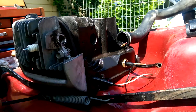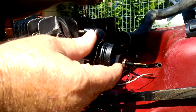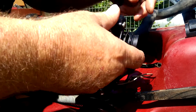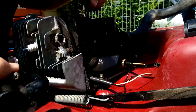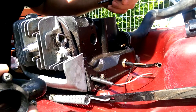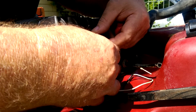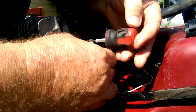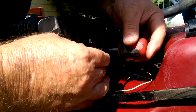In this video I'm going to replace this manifold. People generally don't like doing it, especially if they've got a brand new o-ring on it — it actually makes it harder. The screws aren't fully lined up with where it's got to go into. What I generally do is to just place the thing in the spot where it's got to be, then start tightening the screws down just to keep the thing in place, with gentle pressure on them.